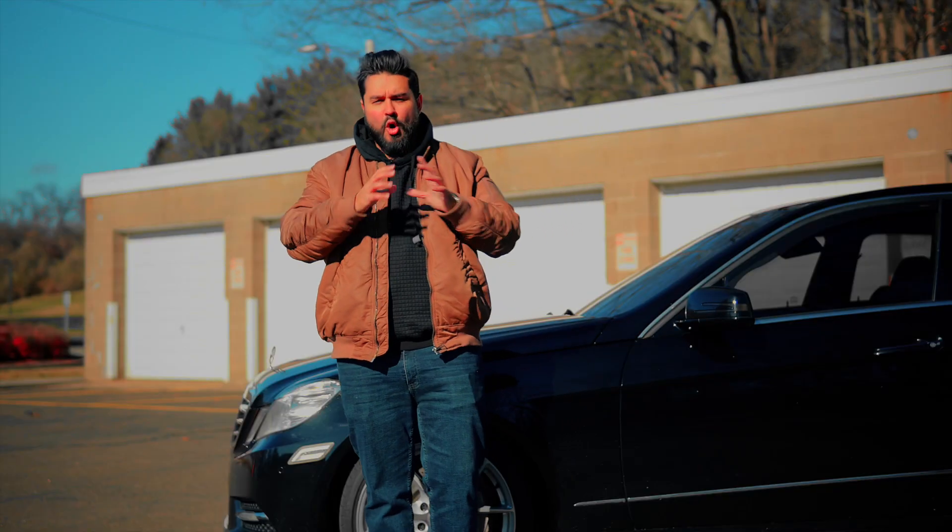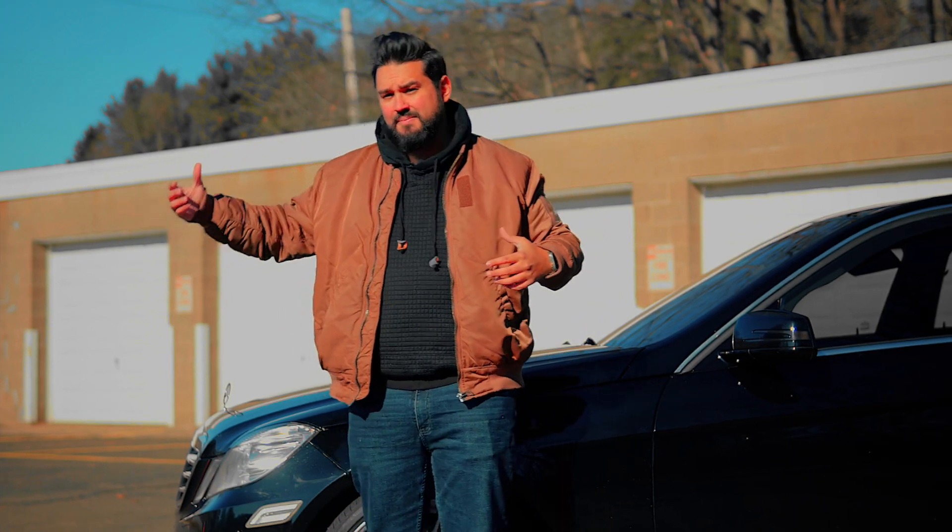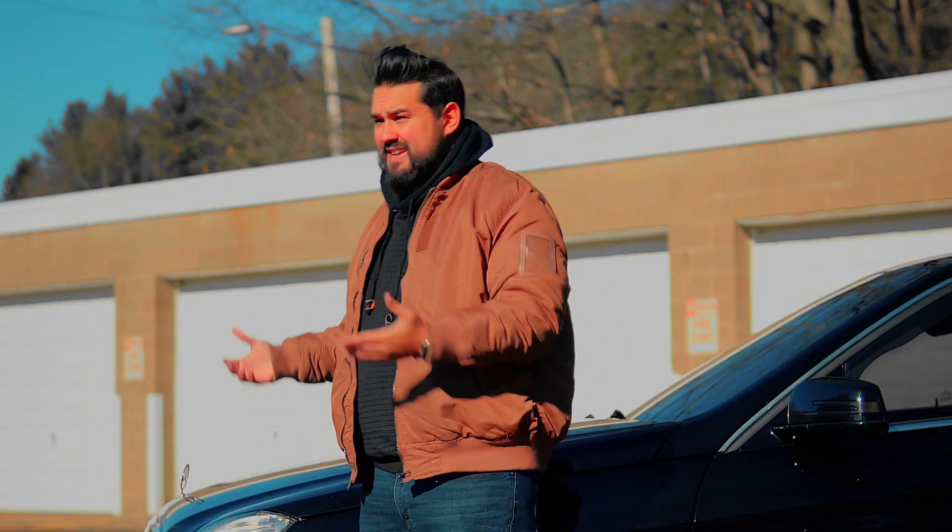So the overarching story is that through most of their lives, most of these cars haven't been getting proper lubrication. We're seeing top-end failures like nobody's business on the M276, M278, and M157 platforms. You see less of it on the M157 typically because it's driven harder and spends more time over that 3,000 RPM range. And even some M278s that are driven healthily tend to last a little bit longer — that's why they say if you drive it, it'll last; if you just putter around, it won't.